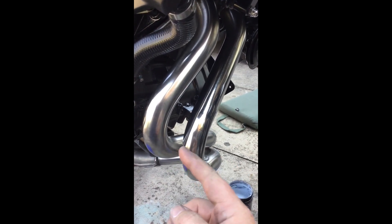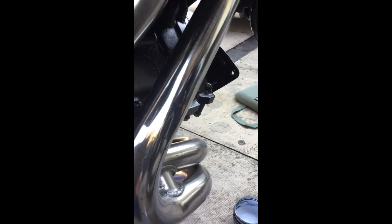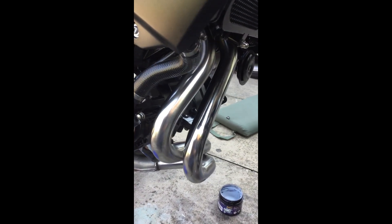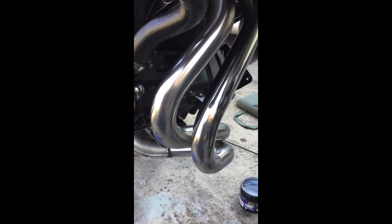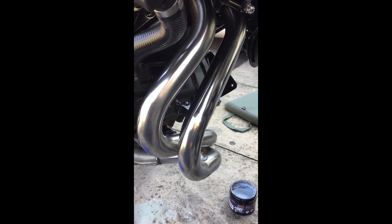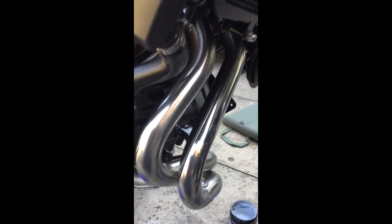As you can see, I've done the front pipe with the Meguiar's NXT. Even though it hasn't taken out any more of the pitting, it has made it nice and shiny. So from a cosmetic point of view I'll obviously do the second pipe and make it all nice and shiny. It didn't take too long — just applied it like the Autosol, polished it in, and then wiped off with a nice clean cloth. So we'll give the second one a go now.